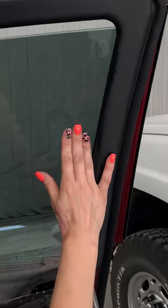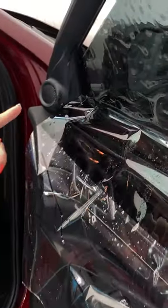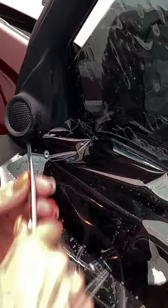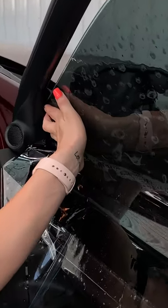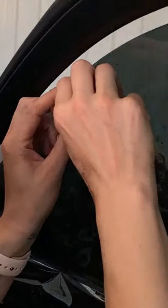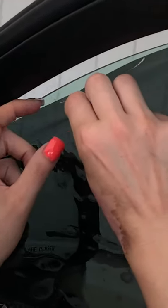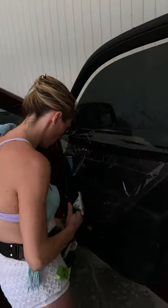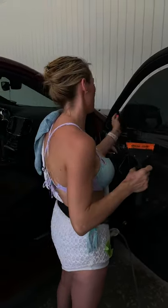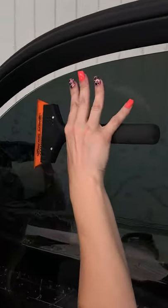Still got a light gap so I'm going to squish it in there a little bit more. I'm giving myself a light gap over here so I can get my dot knife in there. Now we're cooking with apple butter. We want to try to get this micro border going — I think that's about as good as we're going to get. There's a little piece of tint stuck under here from that edge. You've got to be real careful — you want your edge to be as flat as it can be and as micro as it can be. Use the right tool.